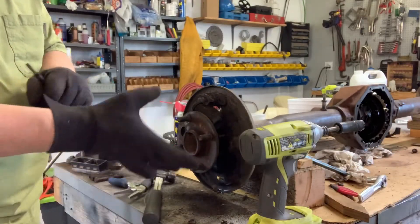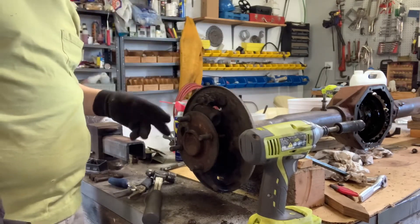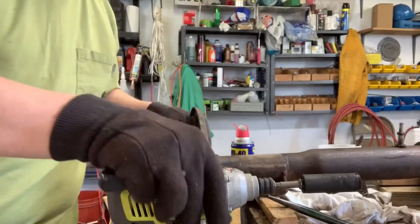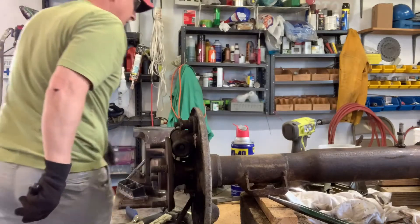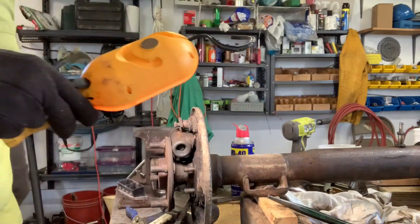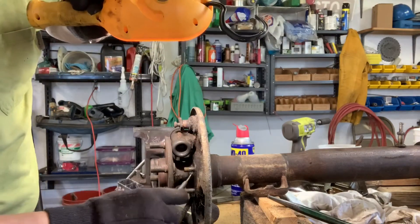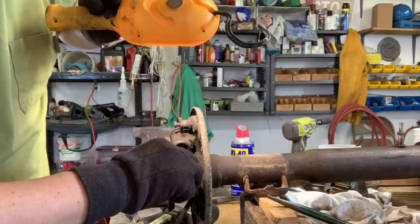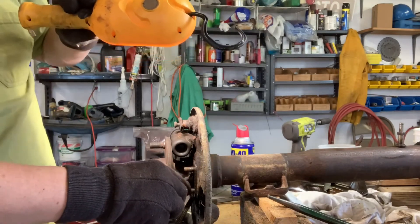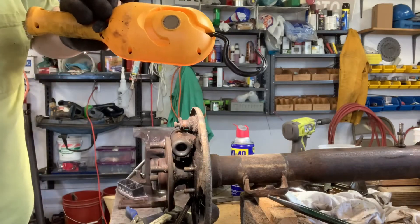I got all the nuts off here. I should have held off — the wheel cylinder is starting to get in my way a little bit. But that's all right. If you can see in here — let me move this around and get a light in there — there's the four bolts, two on each side, and then this cover. There's a gasket behind this cover. Now I'm going to get this cover started loose, and behind that is the seal bearing, and behind that's the seal. I'll just take a wood block and pop it. I'll keep working around on this a little bit and get it loose.